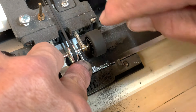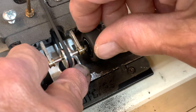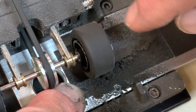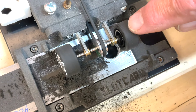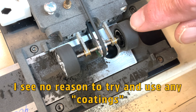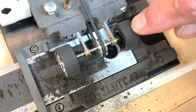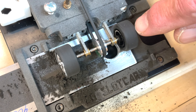Just by sight you can tell you've completely sanded and faced all the way across — and that's really as far as we need to go. True is true. Now we'll do the other side. There's no need to coat these tires to make any sort of zero-grip attempt, because the Carrera stock rubber is gripless to begin with. After about 20 or 30 laps without cleaning, they're about as zero-grip as you could want.